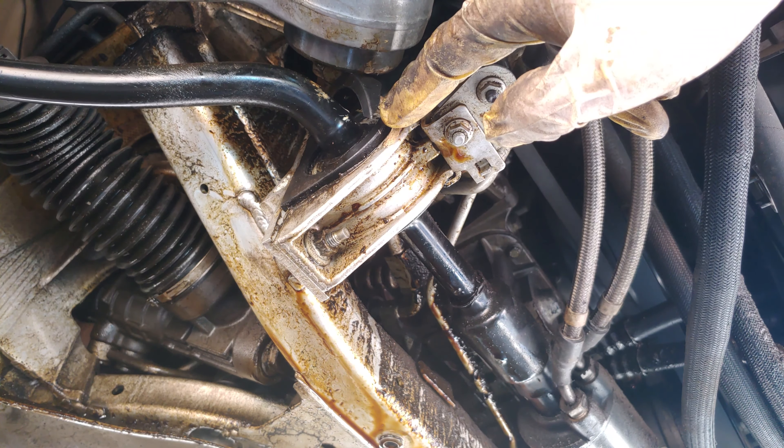You can see it's totally stuffed. Someone has put silicone here — I'm just removing that. Wrap it around the bearing and then put the cover on. This one has got too much oil around it, so clean it thoroughly with thinners.